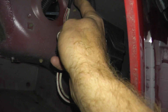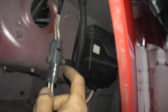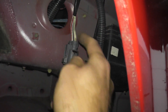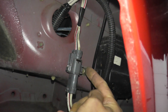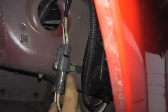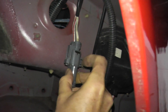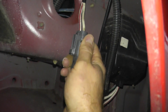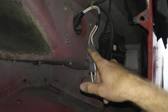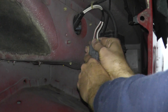We want to verify that power is getting to the electrical current sensor. So right here I need to first unplug this two-wire connector, which is actually attached to a metal tab. It's nice and tight, so at the 3 o'clock position I'm just pushing back this tab and slowly bringing this out. Then at the 12 o'clock position there's a tab — press on the tab, don't pull from the wires, pull from the body.